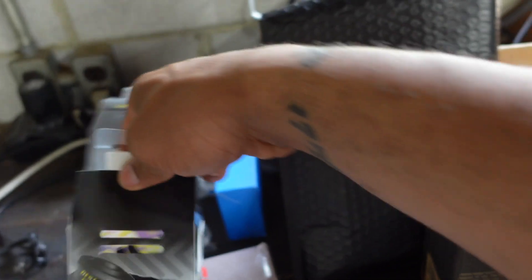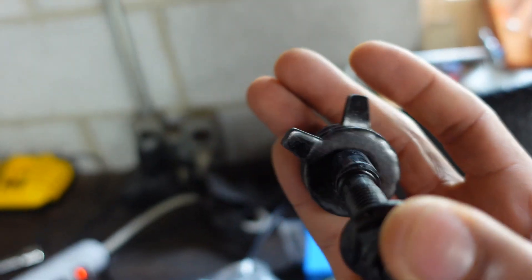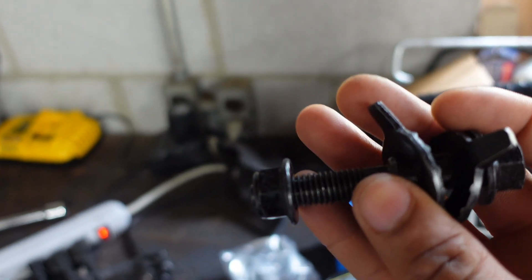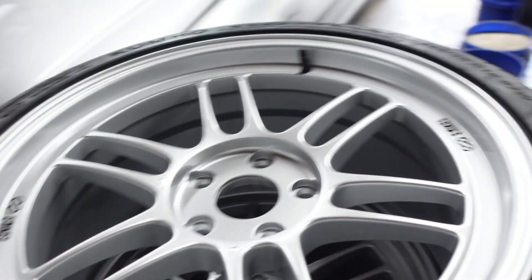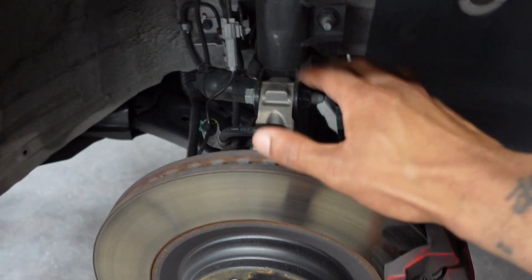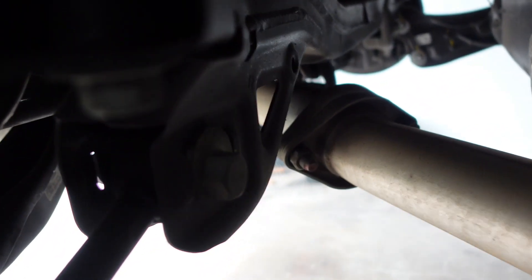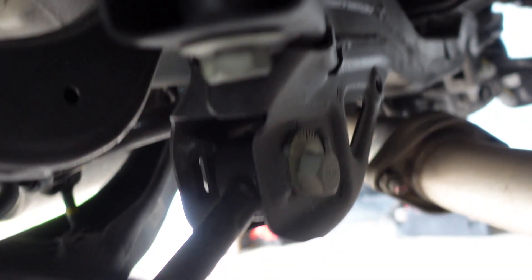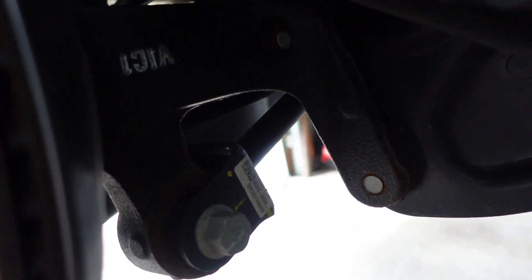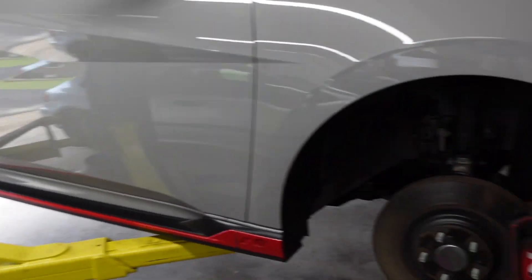Another thing I got was this PowerFlex front camber kit, because in order to make the setup work we do need to add some additional front camber, and the front camber is not adjustable from the factory. The rear camber is adjustable from the factory. I'm going to try and get these fitted — first I'll adjust the camber in the front with the camber bolt, adjusting it to give me maximum camber, as well as in the rear where there is a camber eccentric bolt I can rotate to bring the lower arm out and give me more negative camber in the rear. I'm still at stock ride height with stock suspension.